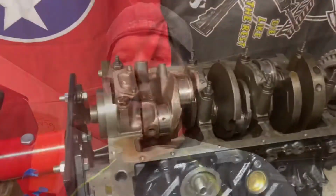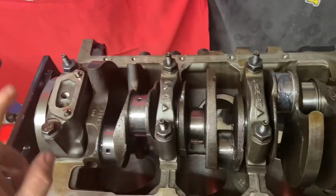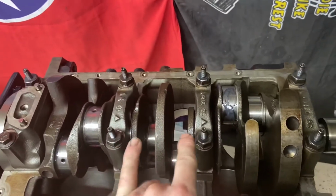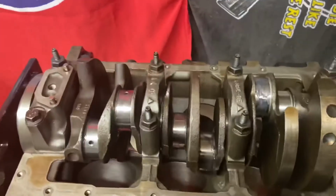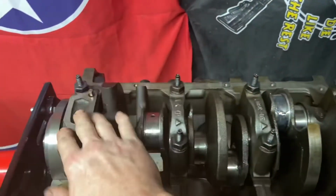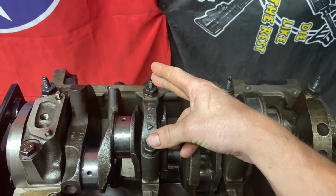And it's not really too difficult, but you're not just going in here and starting to torque them all down to 59 in torque sequence. There's another tiny little step just to help to reseat the thrust bearing. Okay, torque down to 59 foot-pounds torque. All right. So what I did was I torqued them in sequence, meaning basically the inside out. But what I had to do was I torqued all these down to 59 and these only down to between 10 and 12 foot-pounds of torque.